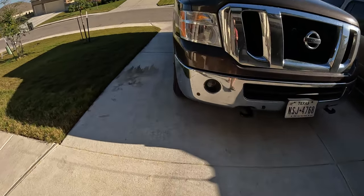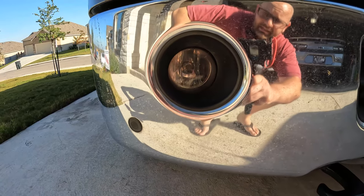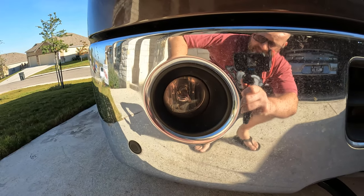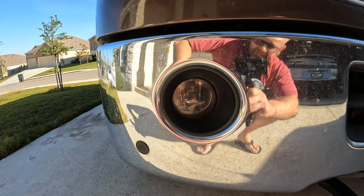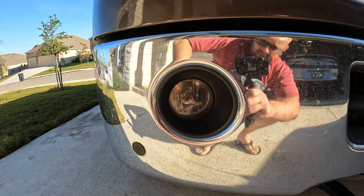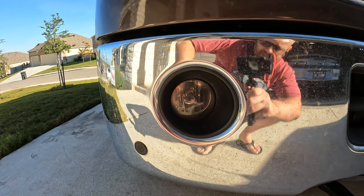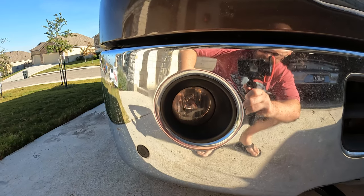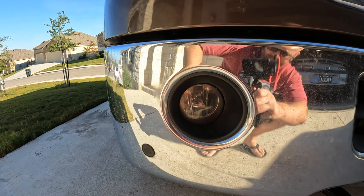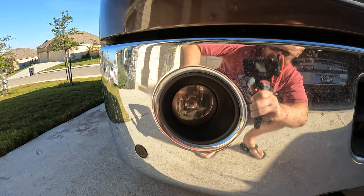Here are the fog lights — typical halogen bulbs. It is daylight out now. I'll start the car up and see how they look in daylight, and I'll splice in a video from last night to show what they look like in the dark. I did get the 3K which is the amber yellow bulb color, which is perfect for fog — the yellow will actually cut through fog, whereas super white will deflect back into your eyes and be pretty much useless. That's why I went with the amber 3K color.